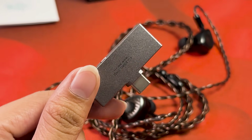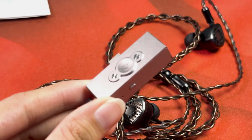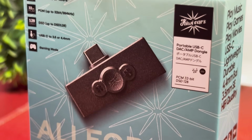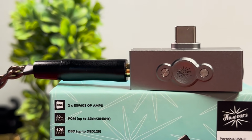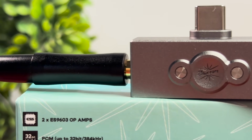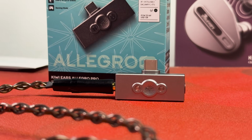And here's where things get interesting, as there actually is a very slight boost around 100 Hz to 150 Hz in all modes. For game mode, I didn't hear any lift in the higher frequencies and upper mid-range. But for the music mode, I heard a very slight tad bit of boost around 4000 Hz region for more energy and detail. Then for theater mode, the boost is around 2000 Hz to 4000 Hz, as I suspected. Now this is designed to lift up dialogues in movies.